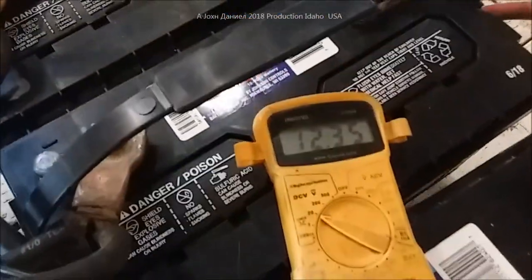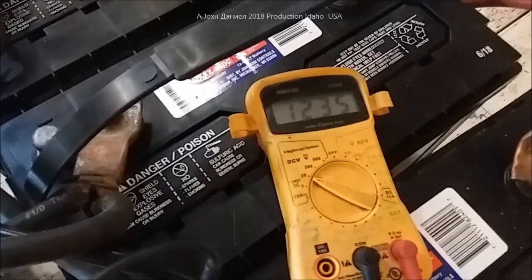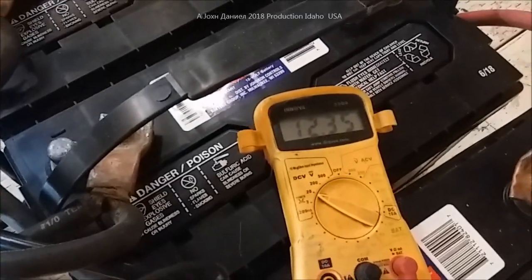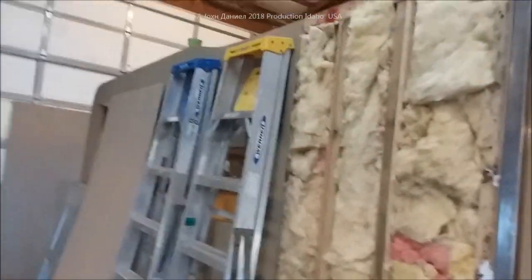What are you running back there? Air conditioning, two fans. So we've got 12.35 volts in the batteries and they're holding - putting out 622 watts. Look at how big this thing is - it's a 21-foot-long vehicle with a bedroom in the front and a quasi living room/sun porch in the back that's screened. There are the windows that'll be going in - they're going to be painted.